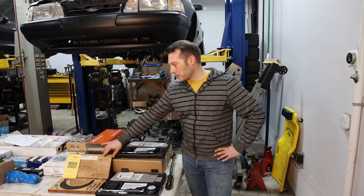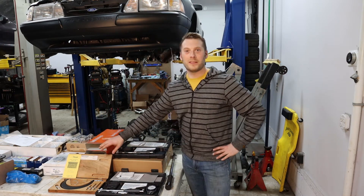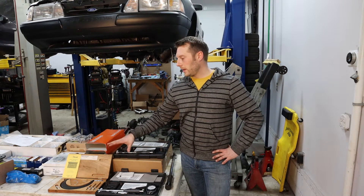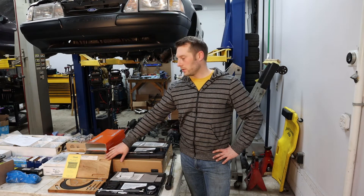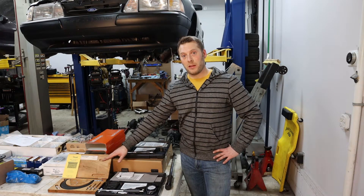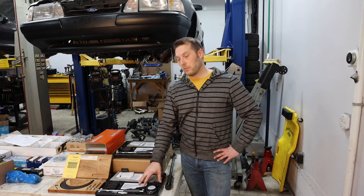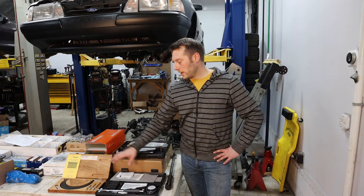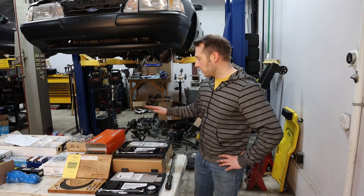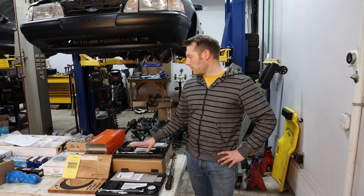The micrometer. This micrometer set is from like 1944 or 1945 — an old used micrometer set. The micrometer needs to be relatively accurate, but it doesn't need to be your best tool. What you're going to be doing with this is comparing the size of the outside of journals — like crank journals — to the dial bore gauge size. The absolute value doesn't matter that much. The dial bore gauge does matter though.